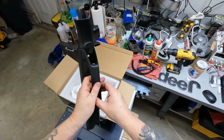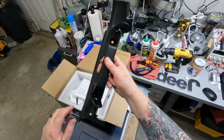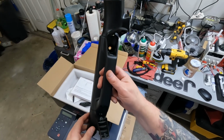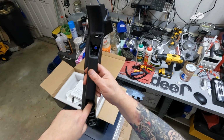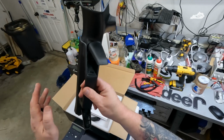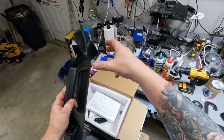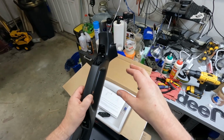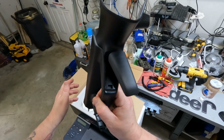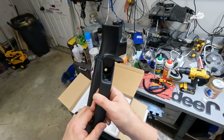Okay, so hopefully you can see things a little better now. Here's the grab handle itself. I think this is the bottom. I think this bolt out here and the bolt out up here. In the instructions, they just have you loosening this bolt, or taking these bolts out and pulling this out this way. It's a lot easier just to go ahead and remove it. I mean, the only added step to the process is to remove that speaker grill, which we already did. So you don't have to remove the speaker grill and just pull this out and fight and cuss to get it up through here, or just remove the speaker grill and pull the grab handle out and be done with it.